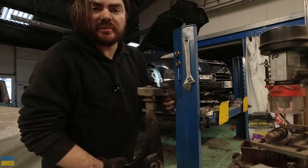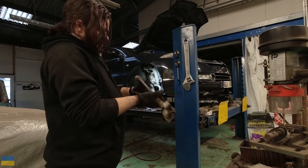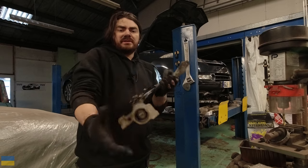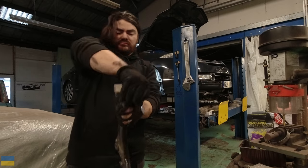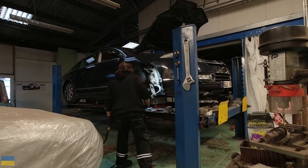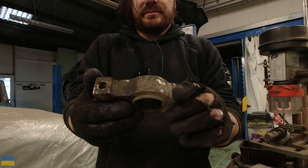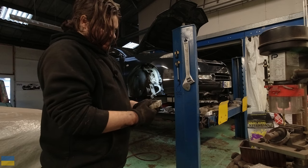One driveshaft out. I'd started trying to pull it apart in the middle — in the BX those CV boots pretty much fall apart. Once I got it off and started levering it and being a bit abusive with it, it started to come free. So that was actually a bit of a result. Now you can see where the shaft used to go through in the big alloy housing. There's the chewed-up bolt still remaining in there — that is reluctant to come out. But now I can get to the remaining wishbone bolt, pull the wishbone out, and then get the knuckle out. Wishbone — that wasn't before time. Look at that — I reckon I could rip that off if I tried. Absolutely cream crackered. Wait — is that the right wishbone? That's a 407 one.